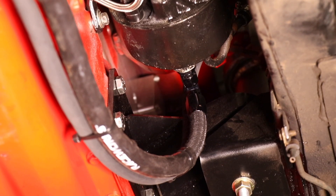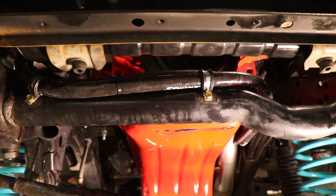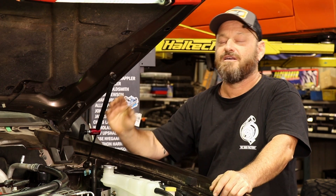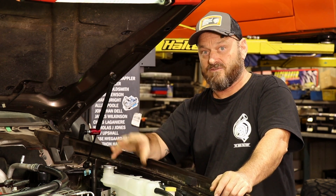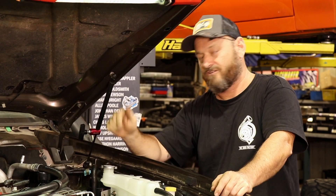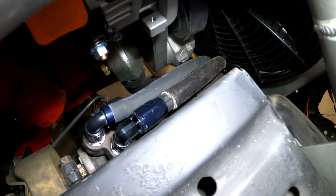The pressure line goes straight from the pump to the box. I have anchored it along the front cross member because hydraulic lines in this case probably have about a thousand PSI under full load — they will whip back and forward if you don't anchor them. So it's got some P-clips and I've also got the return line running alongside it, straight back into the pump. Pretty simple stuff that you can just buy and make yourself so you don't have to pay someone else to do it.